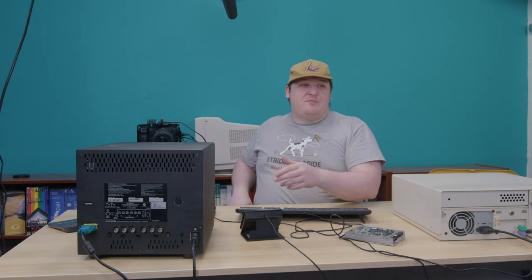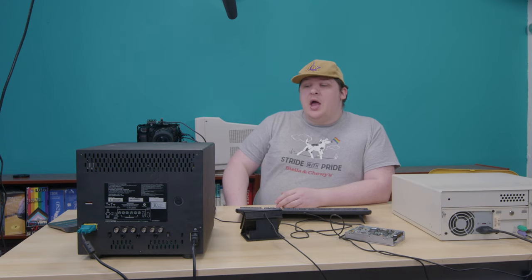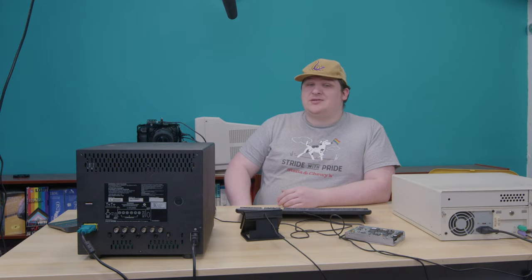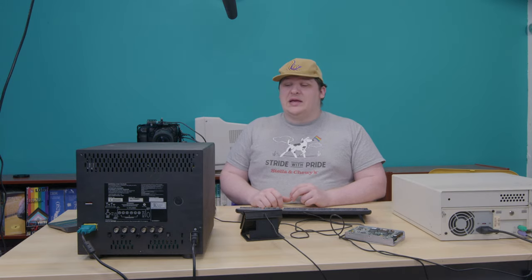So at first I was just utterly baffled by this. I posted about it and I said, I don't understand how this is physically possible. But that's because I was under the impression that EGA and VGA had considerably different memory space. They don't. Apparently, I had known that VGA used a planar addressing mode for video memory, but I didn't know that EGA did as well. Apparently, it had something to do with enabling bank switching more easily, so they didn't have to expand the address space, blah, blah, blah. So, basically, if you give VGA commands to an EGA card, it apparently makes sense that it would interpret them correctly.